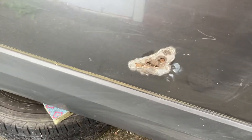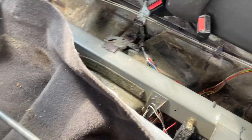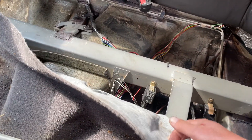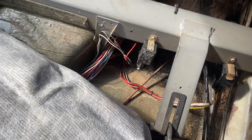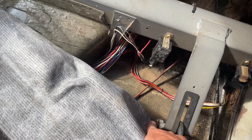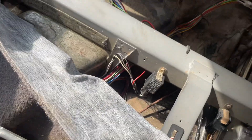I've been inside taking the back seats out. I'll treat that panel and leave it because I'm going to spray the whole panel once I get the kit off. The door seals have gone. Taking the back seat out - on the actual seat part there are four bolts and two U-clamps. To take the whole seat mechanism out there are two shaft bolts with a spring washer.